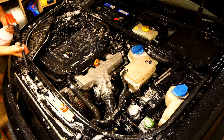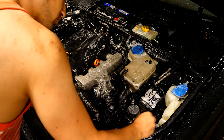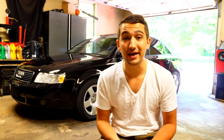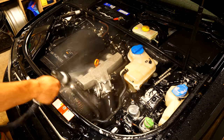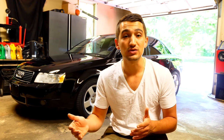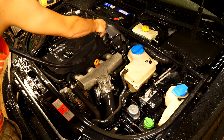For the stuff on top, use a soft bristle brush to get into small intricate areas like between the brake lines. That's what you see most, so removing all the dust between components is what makes it look detailed rather than just clean. An old toothbrush at home can also be handy for this. Once you're done agitating everything, grab your hose and rinse it down. If the engine is very dirty, repeat the degreaser, agitate, and rinse procedure.